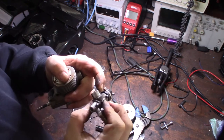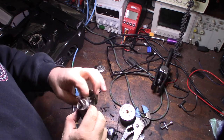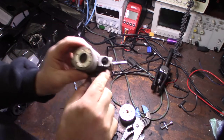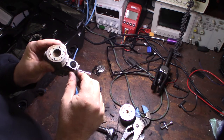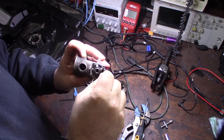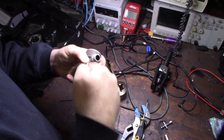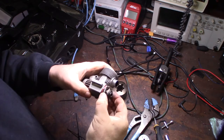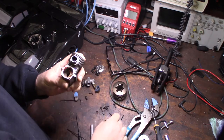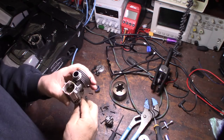I think the guy had the carburetor too tight on there, which created a lot of scoring on the edge. I had to really work to get it off. Yeah, look at that - all scoring in there if you can see that. On the back, it looks like one of these screws was stripped out - it's actually less than M3 right there, I think the rest are probably M2.5. And I hate when they use silicone in there - that defeats the purpose of the seal.